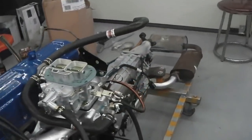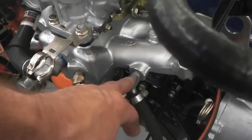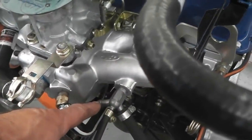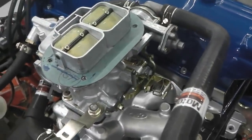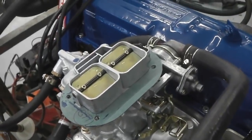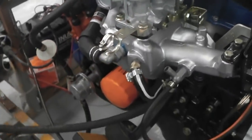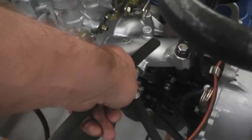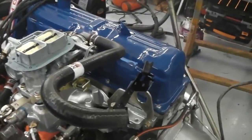We've just got to loop this pipe round here. That's the vac pickup. We're just going to loop it round. This is the automatic gearbox takeoff tube, but we've got a spare one here, an anti-run-on outlet, but we'll just loop that round. I'll do that now, and it's done. I just put that on without a hose clip. It should be okay. Just pop that onto that in a sec. So that's going to go onto there and close that up. That's all that done, and we're ready to go. So let's get some fluid in now.